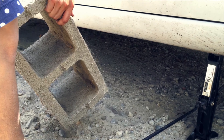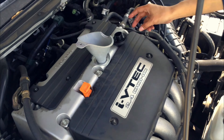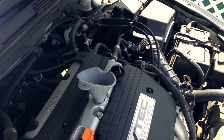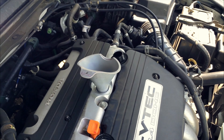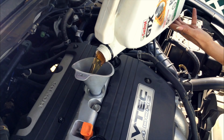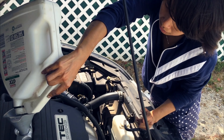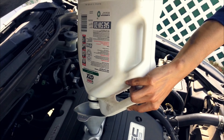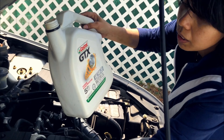It's done! Now we add oil. From last time I still have about two quarts left — new oil. So I need about two and a half more quarts. How much total? Four and a half quarts. Since it's all the way empty it's gonna be four and a half. Make sure the oil is the same type — you cannot mix oils. 5W20 to something different — the number has to be the same. This is the last oil I'm using. If you have leftover oil from before, make sure it's the same number before you fill it in.